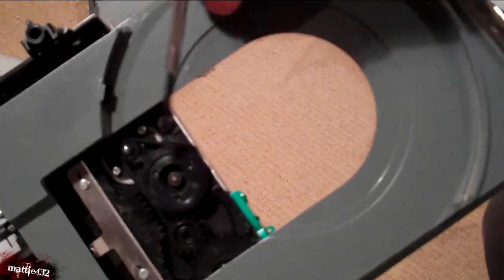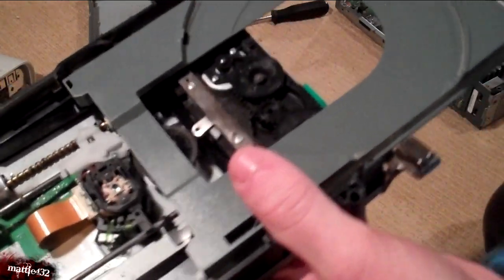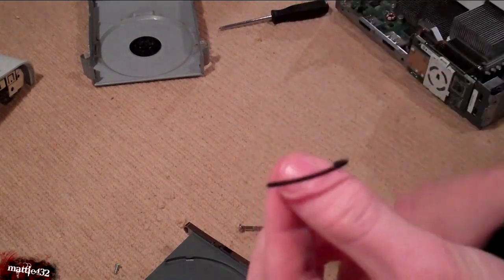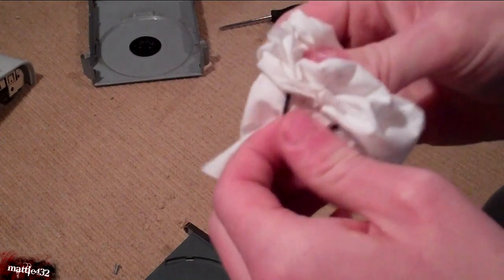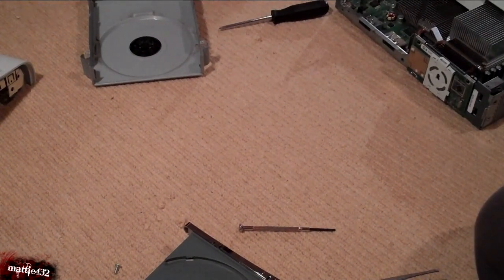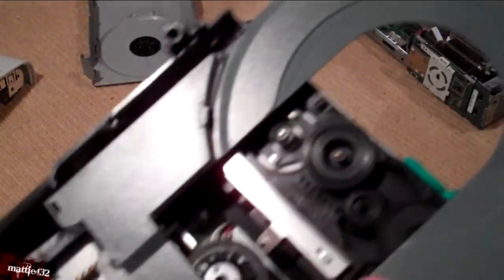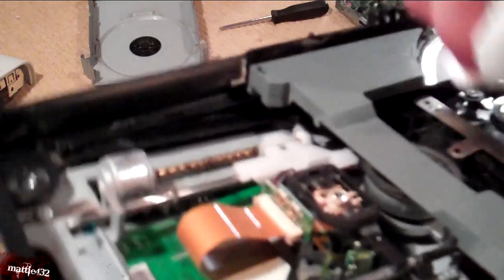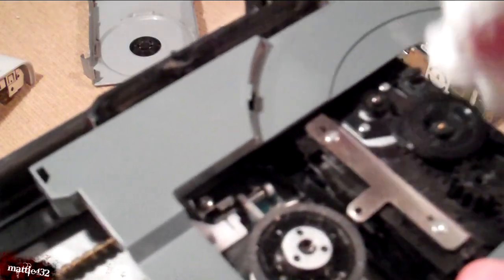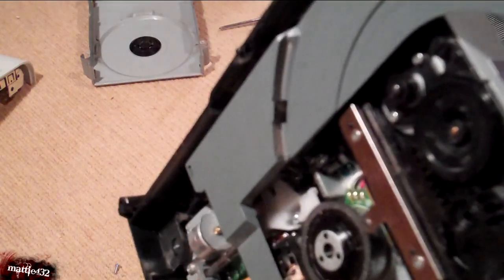This is what you're interested in — the little drive belt there. I would recommend using a pair of tweezers just to take that off, unhook it off of there. Get a bit of kitchen towel and give it a clean — get all the dust off, anything like that. Also clean the cogs. What this actually does in real terms is stops it slipping, which is the usual cause of this problem. Be careful around the laser bit — you don't want to nudge or bodge that.